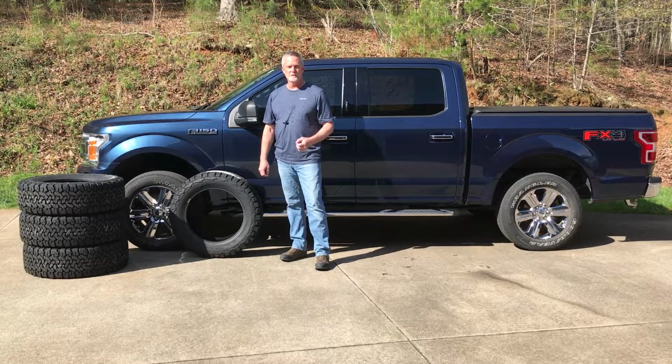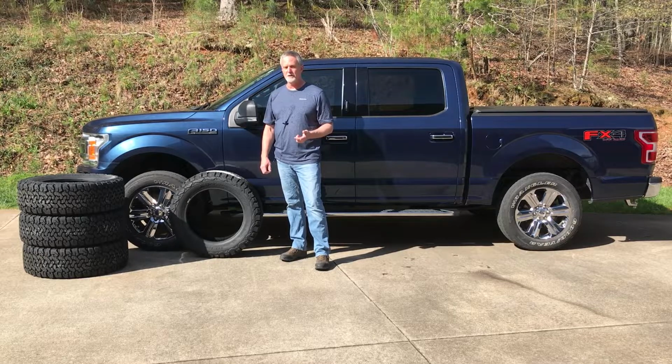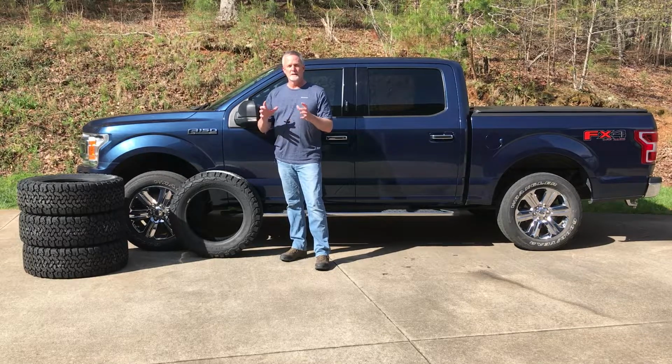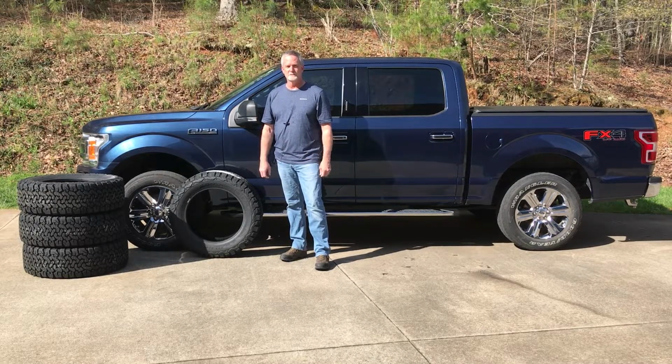In the American Trucks video, they have a vacuum pump that they use in there. You don't have to have that, but it does make the job a lot easier if you put the vacuum pump on there and disengage the 4-wheel drive. So when you go to put it back on, it'll slide right on, and then after you get everything bolted up, you can release the vacuum and turn your rotor to make the 4-wheel drive engage. It just makes it a lot easier.